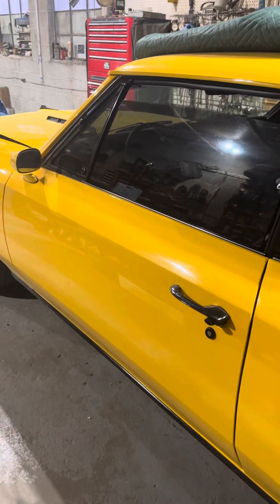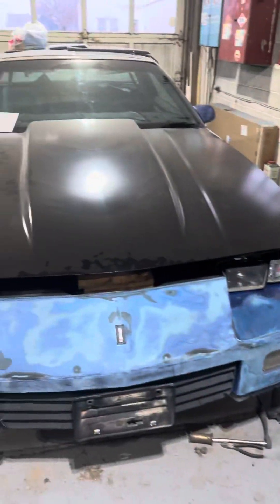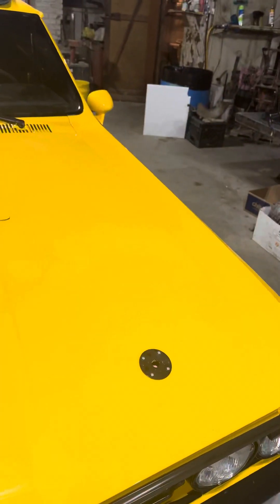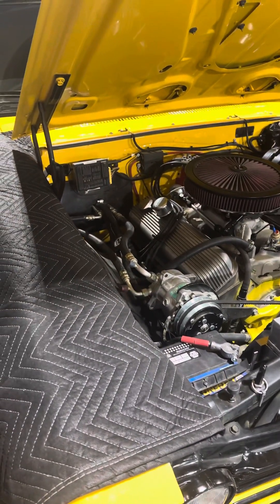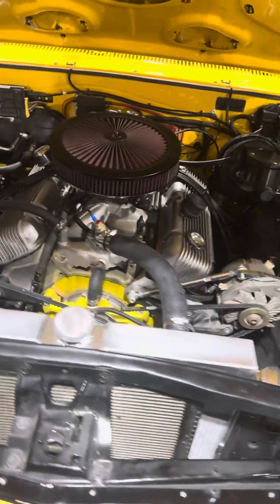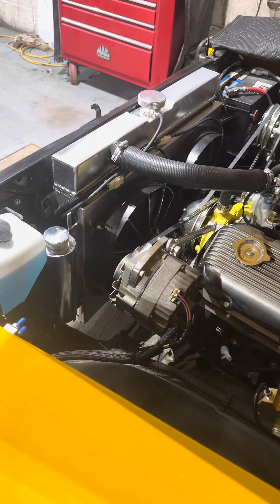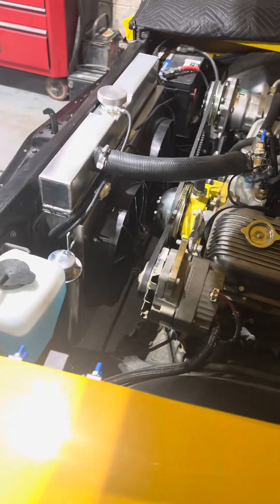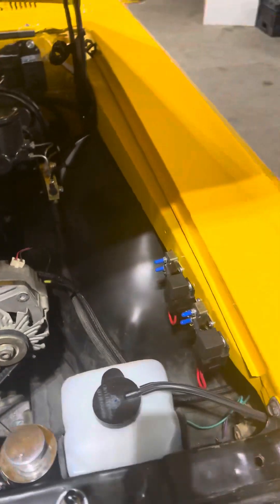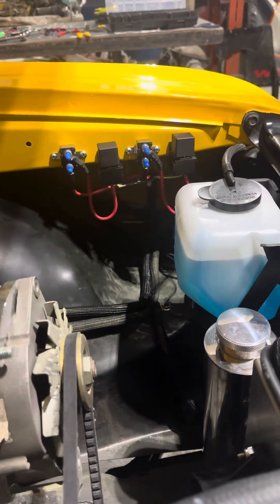For any of y'all that have been paying attention to my absence on the channel — work doesn't stop. Back to fixing that hood, that's fun. We don't quit, there's plenty of work to do. Just a matter of trying to get it all lined up in a part-time one-man shop like I am. Finally got wires hidden and tied together for those electric fans — they were not fun. But we got the breakers and the relays moved and wired in, so they are serviceable now, easy to work on.